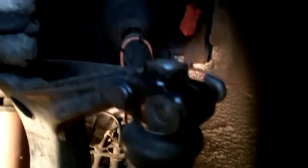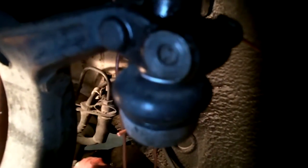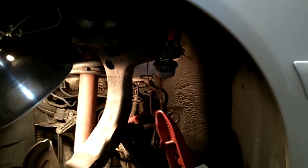This is the second to last piece of the puzzle that I'm going to do. So I'm going to remove, I believe this is called the control arm here. It kind of connects to the steering rack, I believe. It might be hard to see, but the pin that went through this knuckle here has a flat end, and it looks like it's facing towards the front of the car. I removed this nut and this bolt. The nut was on this bolt here, and this was sticking through. I just hammered it out, and then the bolt that I just showed on the floor was in the top up here. So now the fun part of trying to pop this free.